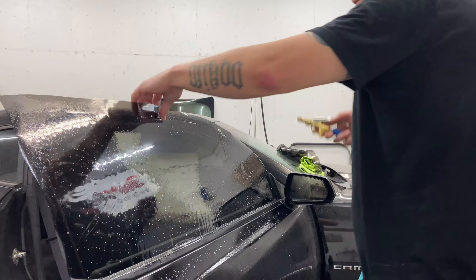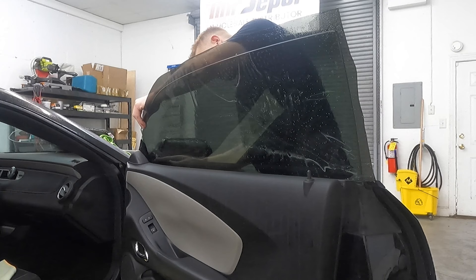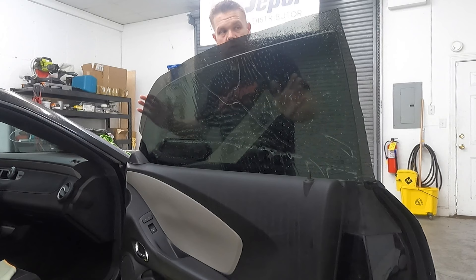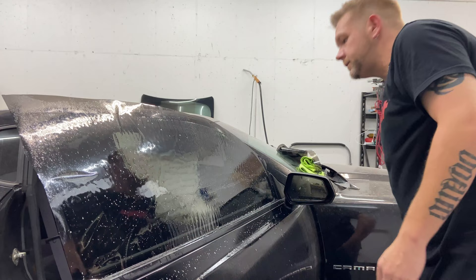Now we're going to unlock the film. Wet where it was squeegeed. We want to pull it over that front seal about an eighth of an inch — remember the film is going to move just a tiny bit forward when you install it to expose the back edge, so do an eighth of an inch. Always check your inside seal to see how close it is to the outside; sometimes they're a little further off and you need to go a little further with the film. In this case these are dead even, so about an eighth of an inch is just fine. Check your bottom edge again — make sure you're lined up. Looking good.